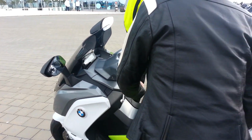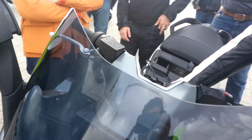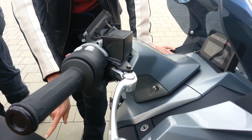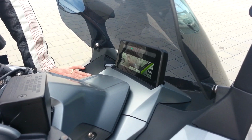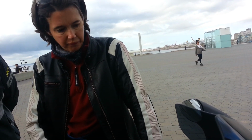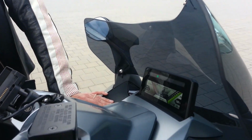When you want to start the scooter, you switch it on and actually turn it off once more. Listen, click. These are the high voltage relays connecting. Before you turn on the ignition, there is no high voltage outside the big aluminum battery housing. The vehicle is constructed as an intrinsically safe vehicle, as we went into detail yesterday. Now it is ignition on, not yet in running mode.